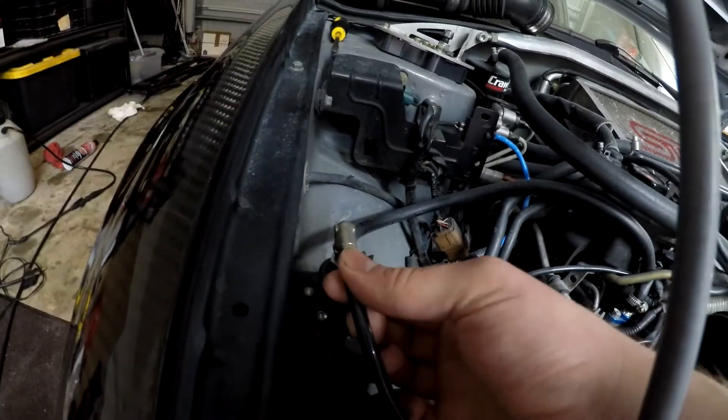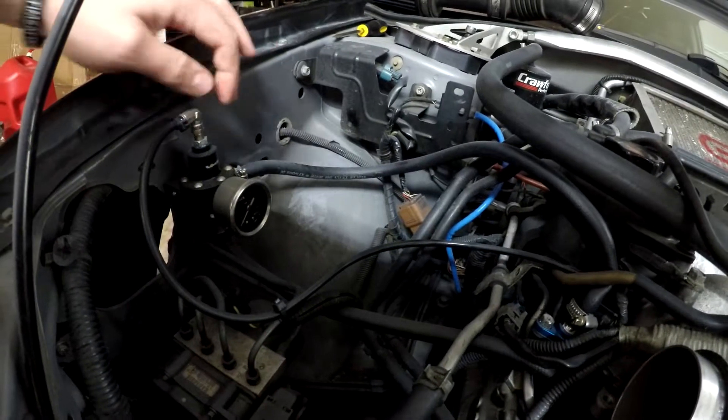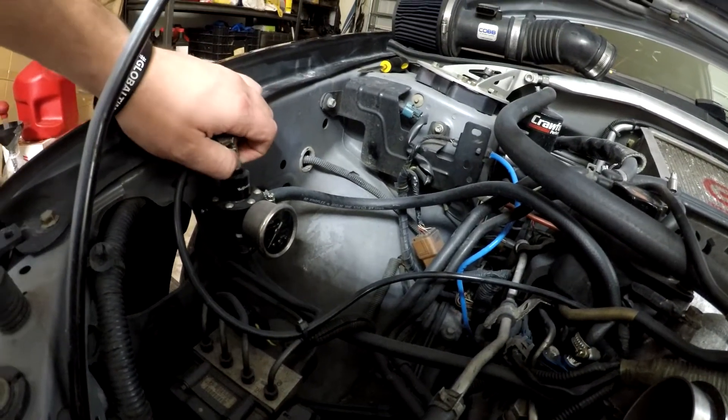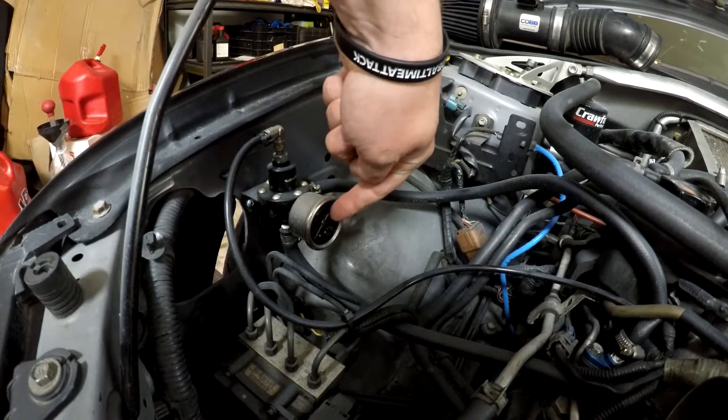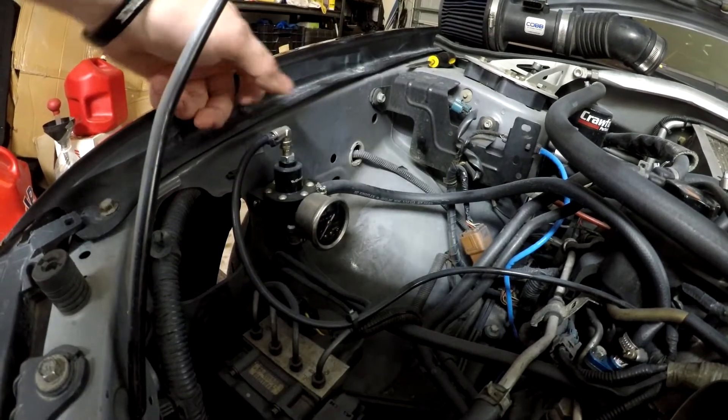When I talked to my tuner about what fuel pressure to preset it at to make sure I'm not throwing off my AFR, for my specific car and tune — and it might work for most Subarus running E85 — he said 43 and a half PSI with the vacuum pressure reference off. So when you're setting the line, just leave the vacuum line off, turn it on, have the car running with the pump running. Right here you can loosen this and when you spin it, it will start to jump around on the pressure gauge — left is down, right is up. I set it right in dead center between 43 and 44.